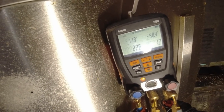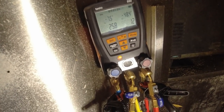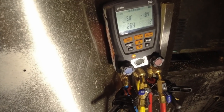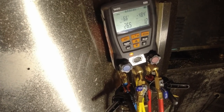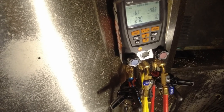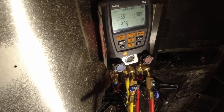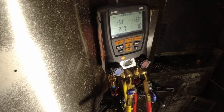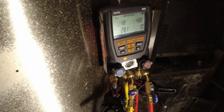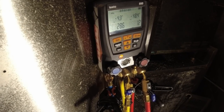It's starting to come down. I had a thermostat wire come unplugged. We're at 22 pounds, about negative 11°F — this is actually a freezer, which is why I was confused about the defrost clock. This has been a haphazard situation; I was supposed to be on one piece of equipment and now I'm working on two. We should have been here earlier. Now that I realize it's a freezer, let's check the defrost clock and make sure there's amperage on that heater.